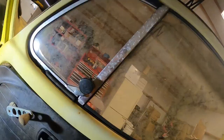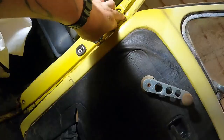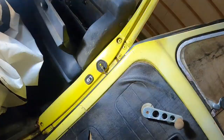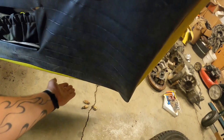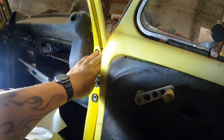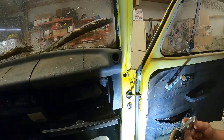One problem is my window — it doesn't want to go down. My initial plan was to loosen them all up, pull out the bottom three and two of the top ones, and then just kind of support this door with my shoulder. But I can't get this window to move, so that'll be another video when we rip into this door. I guess what we can do is go get a jack, support the bottom of the door, do the same thing with these top screws only the door is supported out on a jack stand, and then get this thing out of here. Let me go grab a few tools and we'll see if we can get these screws to budge.